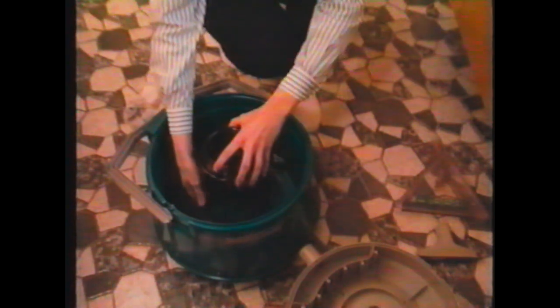For more thorough cleaning, you may rinse the filter or wash it in the washing machine and let it air dry. Wipe the recovery tank, ball cage, ball, wands, and tools with a damp cloth. Put the ball and ball cage back into place in the recovery tank after drying.